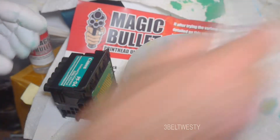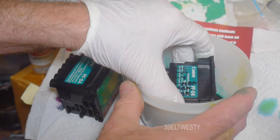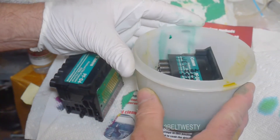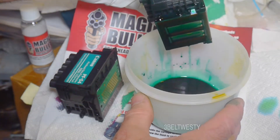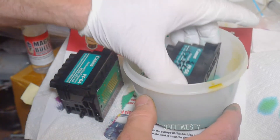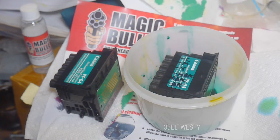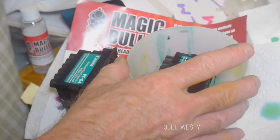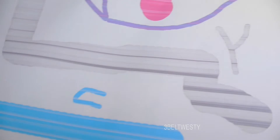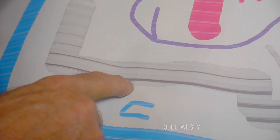The Magic Bullet comes with a couple of syringes. If it's just a mild clog, you can just soak it — that's what I've been doing here. You get a container that's just larger than the cartridge and soak it in there. After soaking, you're going to get some prints that come out kind of washed out. I printed a whole bunch yesterday with no yellow, and so I've got a test print over here. That's the cyan.